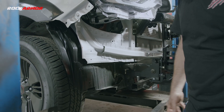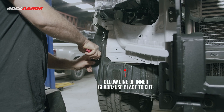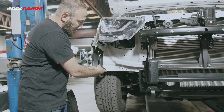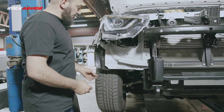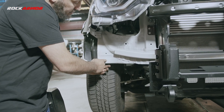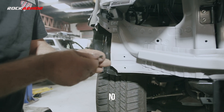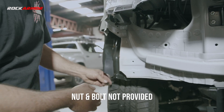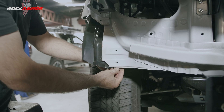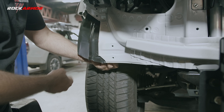I've just cut this inner guard because it's going to make it easier a little bit later on. I've cut and flushed that line there — I'll clean that up once the bar's on. To mount this in place, I've marked out my point on the inner guard, drilled it, got the 10mm spring flat, and from the inside I'm just going to fix this inner guard in place onto the body so it's nice and firm.